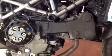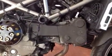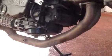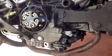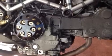See what you guys think. Online, a new starter is $200. I think it does have a good ground — I think the cover of the starter motor is the ground. I think I have a good battery too. This marks 14 volts, and then once I turn the key, it goes down to like 13 or so volts.